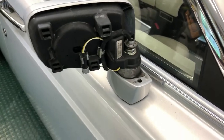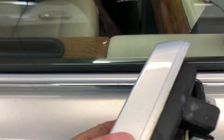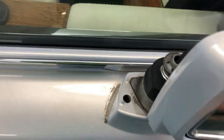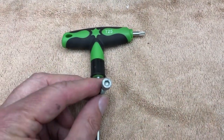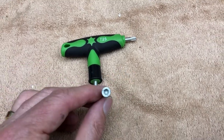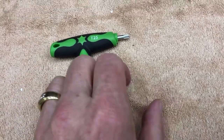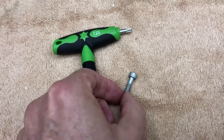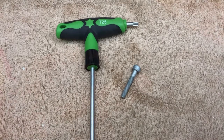The mirrors are held on by two screws each — one here that you can get to with the mirror in its normal position, and the other one you can reach by just rotating the mirror sideways. The screws take a T25 Torx wrench. Keep in mind that when I went in to remove a couple of the screws, one of them was rusted out at the very top.